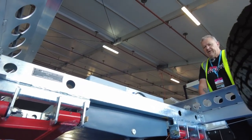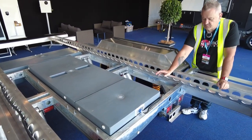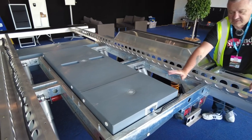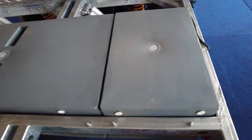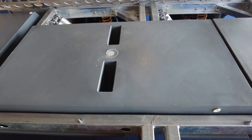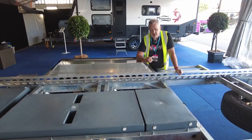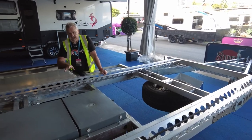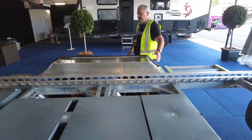The sub-assembly has also been made specifically to house these water tanks, which were custom-made for it. The tanks contain 190 litres and 60 litres. The 60-litre is for drinking water — completely isolated, with its own totally separate plumbing. The 190-litre is a general-purpose tank. Having the water positioned here has no impact whatsoever on the ball weight — this van will always tow exactly the same whether the tanks are full or empty, and that is a big deal.